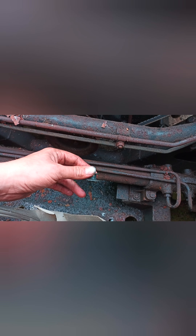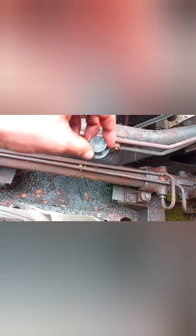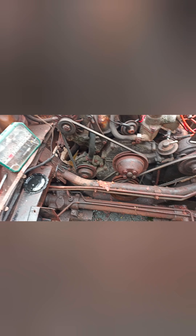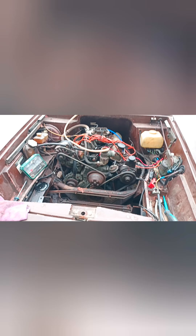I'll just take this radiator off so I can get it out and clean it, and see how bad it is. One thing I did notice — when I picked this car up it had no ATF or automatic transmission fluid in it. But I just noticed this little cap which looks like the ones on the ATF where you pull them up and they've got a little nozzle you can pour them in. So I'm thinking: has this had ATF in before and has it got a leak on the gearbox? We'll find out when we get to that end of the vehicle. Worst case I'll have to take the box out, get it reconditioned, or get a second-hand one for about a hundred quid, or a recon unit for about three to four hundred.